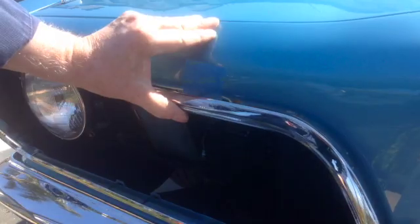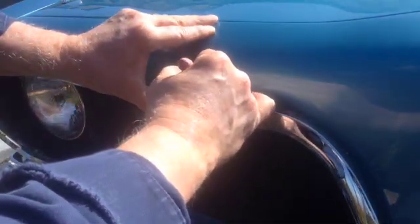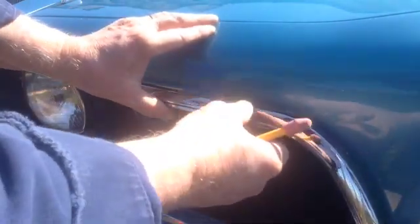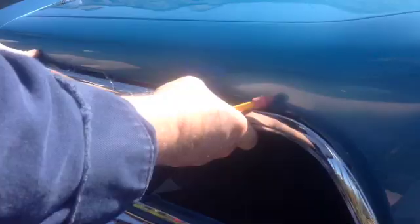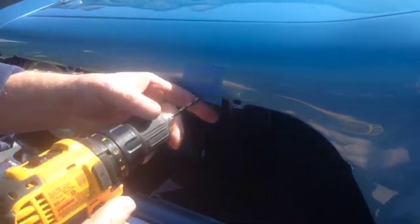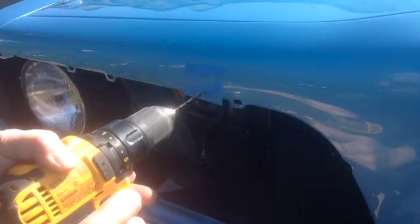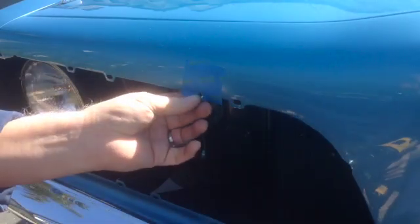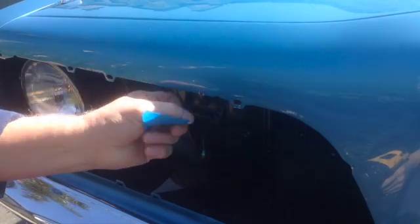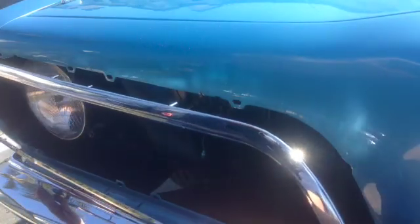To begin the PG grill alteration, drill the header hole. Place a piece of tape on the passenger side of the header and mark where you plan to drill a 3/16 inch hole. Be very careful. Test to fit.